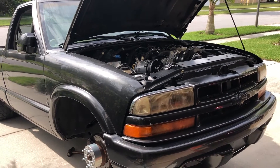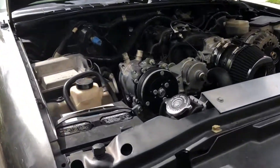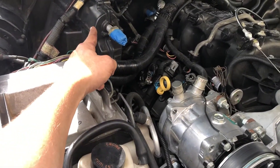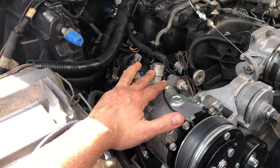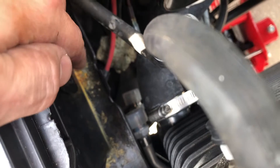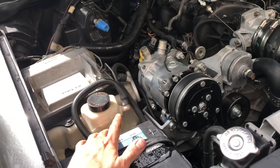So what I'm doing right now is trying to get the AC working on this thing. I've got my compressor in place — had that there for a while. Today I'm changing out my evaporator core. I've got the stuff I need to make up my custom lines, and I'm going to do that this weekend. I've gone ahead and swapped out the condenser core coil — you can see down there. I need to paint this, look at that rust. Anyways, I've got the new condenser coil in there, so I'm going to change out the evaporator coil right now.